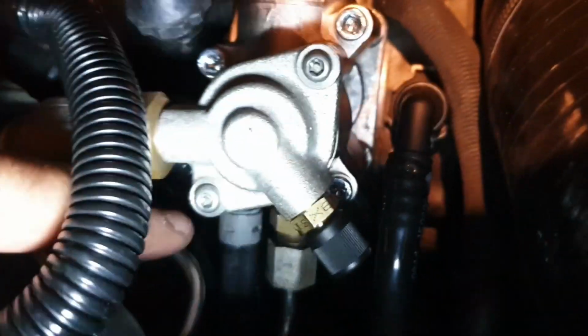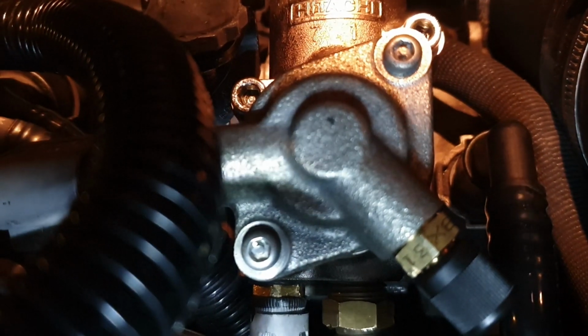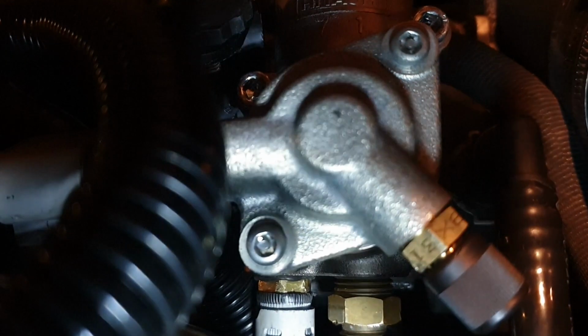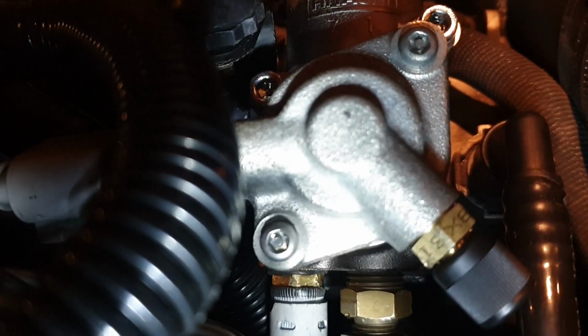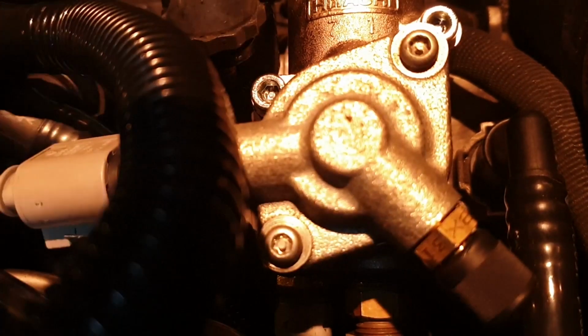took the whole pump inside. Be careful, inside there you'll see there's a brass nut. When we took it out, there's a crush washer which goes between the brass fitting and the fuel pump, and then on the inside there's another washer. We actually managed to drop both of them. Because of that, it wasn't sealing as it should.